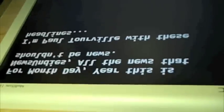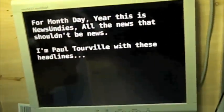It's a 15-inch LCD monitor down here — I think I paid $100 for it a while back, back when LCDs were a lot more expensive. And this is the half-silvered glass sitting in a frame which I made out of aluminum angles. From here you can't see the text on the half-silvered glass, but if you come around here you can. So that's the prompter. Just a little tip: the half-silvered side is on the side with the monitor, not the other side.